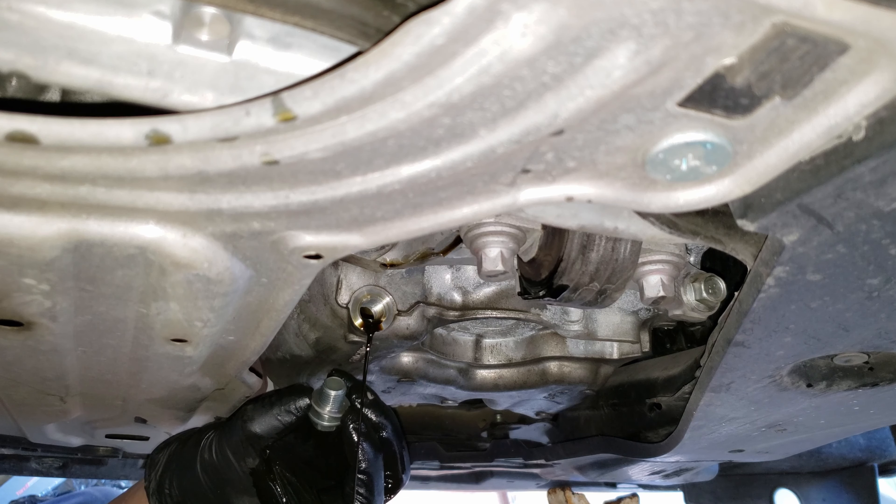With about that much oil in, let's go ahead and check the oil level using the dipstick to see where we're at. We always want to wipe off the level the first time because it may have the old mark, then slide it back in and check it. For now that's a good level — just below the full mark — although it will go down once you start it and it fills the oil filter and oil passages.